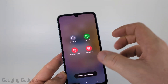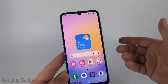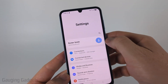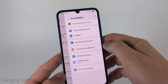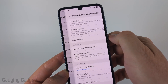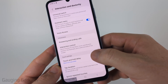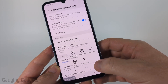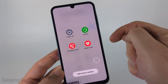Now if for some reason you can't get into this menu, there's another way to open up the power menu through the accessibility settings. Swipe up, select settings, then scroll down to the bottom and select accessibility. Once in accessibility, select interaction and dexterity, then select assistant menu. You'll see a new item show up on your screen — select that, then swipe all the way to the right or use the arrow, select power menu, and then select restart.